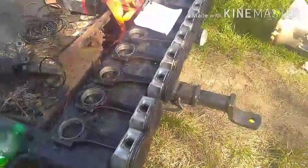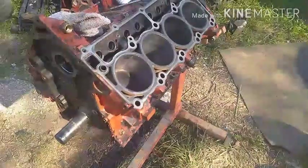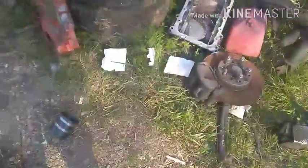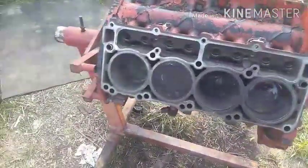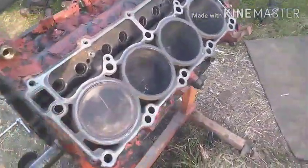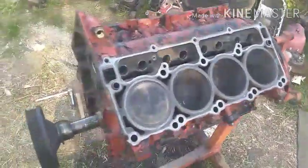The rings ain't never going to touch unless I literally melt the engine down, and at that point everything is at risk of dying - so it'll be fine, don't worry about it. Putting the pistons in with assembly lube. Oil rings on - darn spring compressor thingy fell on the floor. Pretty standard stuff - didn't flip them, didn't spin them, be all right. All eight pistons are in. Like, comment, subscribe - thanks for watching. Next video we'll do more. Bye.